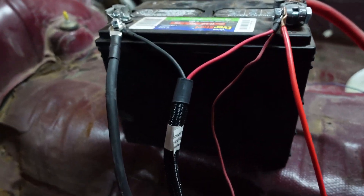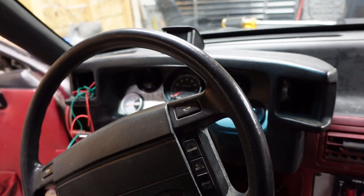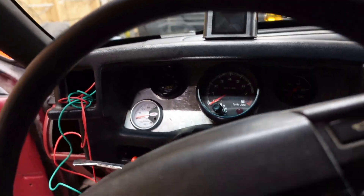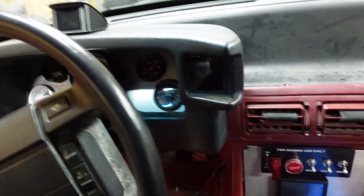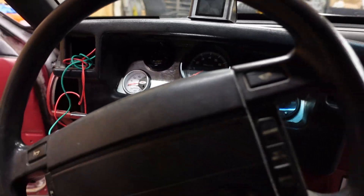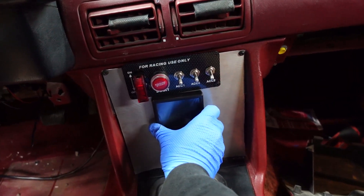Let's go ahead - I got the main harness that powers the Holley Terminator hooked up. You're not supposed to put it to a switch, just put it up to the power and to the ground. I have it ran underneath. I've been debating for about 20 minutes now where I want this screen. I kind of wanted it right there but you can't see it - I wish it was right here. For now I'll just mount it right here. Everything is looking very clean. I think this is going to be an issue now and this is not going to work as well on my AEM gauge, so I need to technically take those out because this is what it's going to be running.